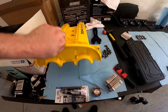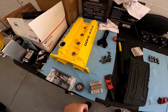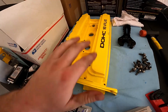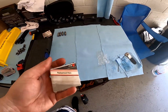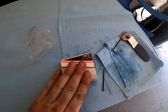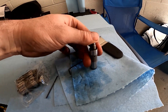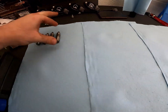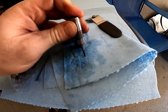Baffles are in, everything is going great. Threw some wax on the cover — just some Meguiar's quick wax spray, wiped it off, good to go. It's got a smooth feel and it's going to look great on the car. Now I've got my ITM lifters and I'm going to be bleeding these. When they come out of the box they're pretty hard. What you do is get a little allen key inside — I'll show you. A lifter straight out of the package, if you press on it it's pressurized and won't really move. The ones I've bled I can move by hand. Put a little allen key in the top, find the little valve in there, and let it bleed.